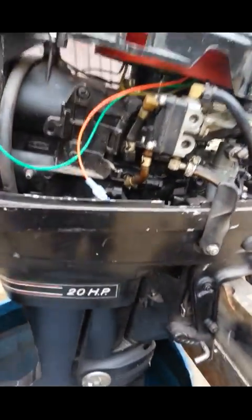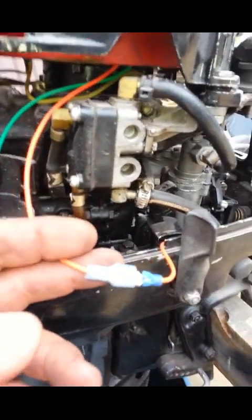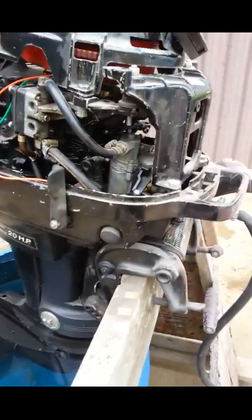I'm going to put it in a test tank - I am not going to put muffs on it or anything like that. It is going into probably a barrel. Our big test tank right now has a big Yamaha in it. Our barrel is full. Here's our 20 horse - here's the stator that we got back saying it was okay, still hooked up, in a barrel of water, no muffs, no back pressure. I'm going to fire this thing up.